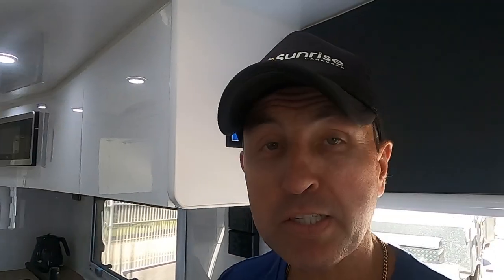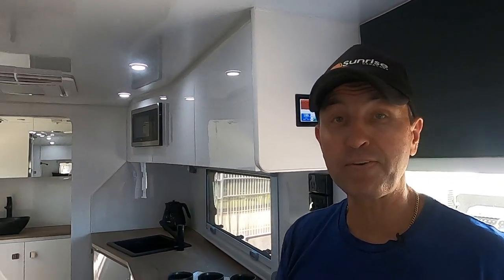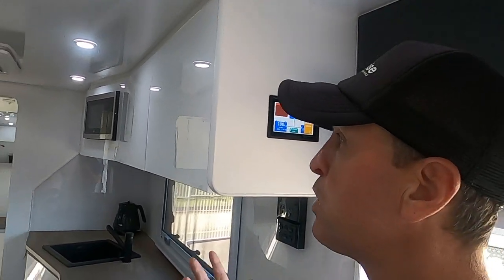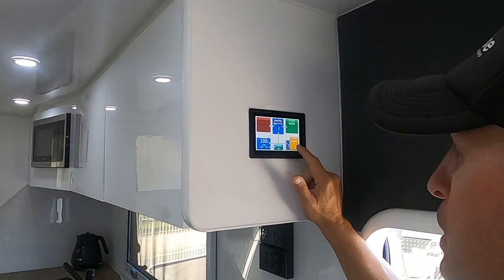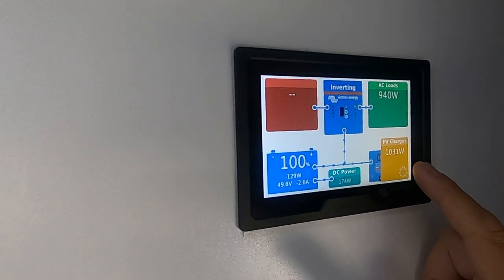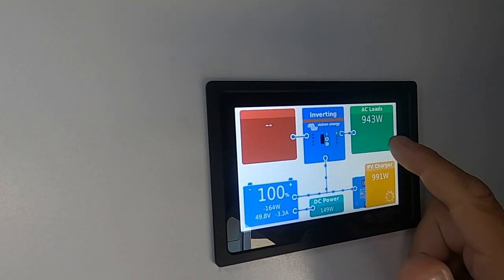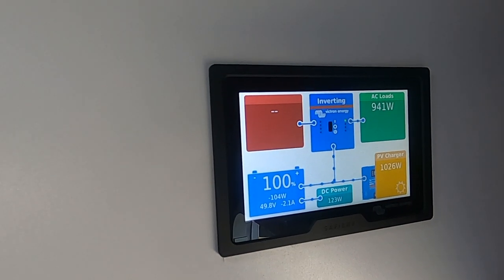Let's come straight to the screen here. We have 1500 watts of solar on the 48 volt Safari system, but the battery system in here is equivalent to 800 amps of 12 volt — wow, that is impressive. If you want to be off-grid, this van will enable you for weeks, even months, replenishing from the sun. Since 9 o'clock this morning we've had the fridge and the aircon running. It's about 2 o'clock now and from the solar we've got 1,036 watts going in, with the fridge and aircon using 943 watts.